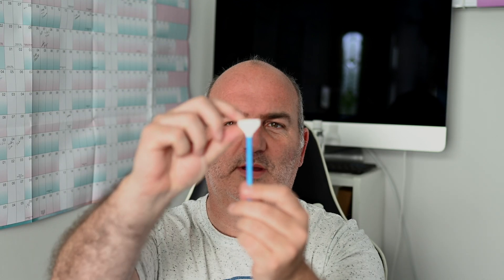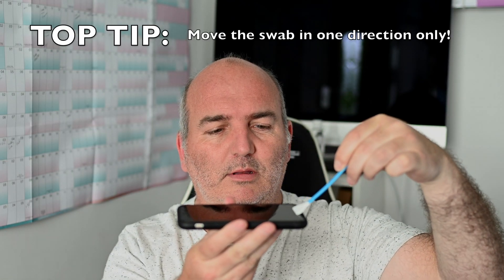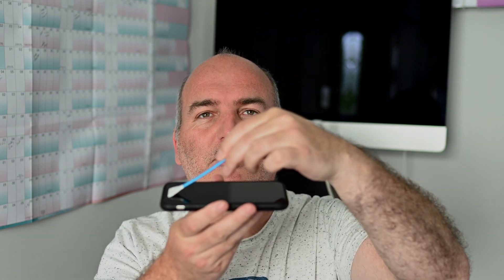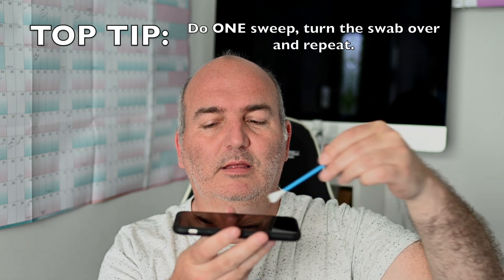Here's a dirty one from a previous outtake. The APS-C swab only comes to about here, so it wouldn't cover the full sensor. We're not actually going to be touching the sensor itself — there's a protective glass layer over the front of it, like a screen protector on your mobile phone. With this swab, we're just going to be pressing gently like that, not hard at all.